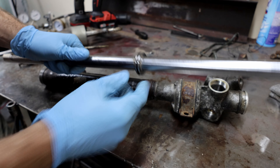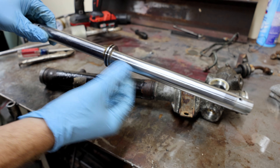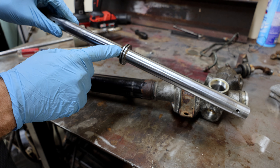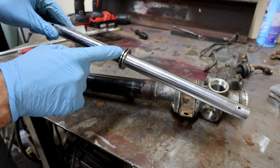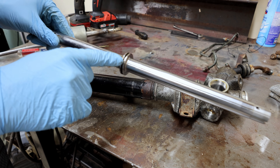After disassembly, this is basically what you have. This is a sealing area, and this is the two halves of the piston. This is held on with a retained wire snap ring, so this has to be cut off. You can't take the snap ring out to remove this, so the first step is to cut this with a cutoff wheel.